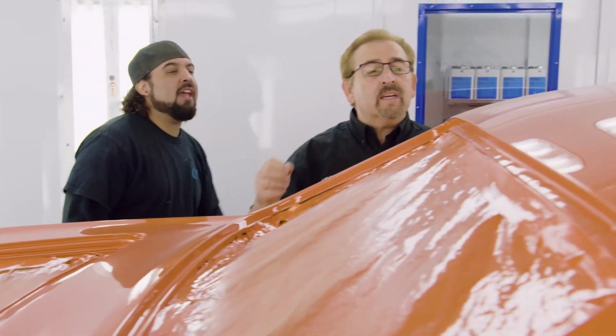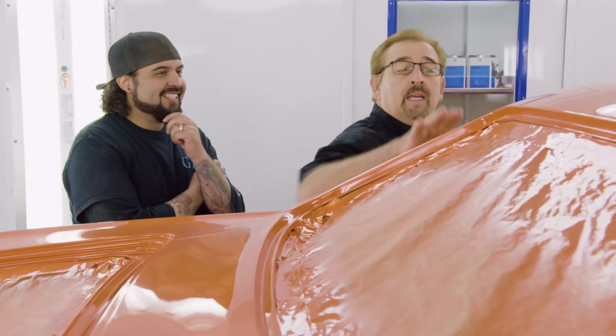Why would you do this? Okay, when I walked out, it wasn't here. I come back in and the thing, is it the last coat? It's on the last coat of clear. When I painted, I got the same thing. You can't control everything. All you've got to do is walk out into the shop one time and back in while you're waiting for flash coats, and a bug can get in there. Yeah, fly killing mother. Anyway, I would recommend maybe cutting him out with a razor blade.